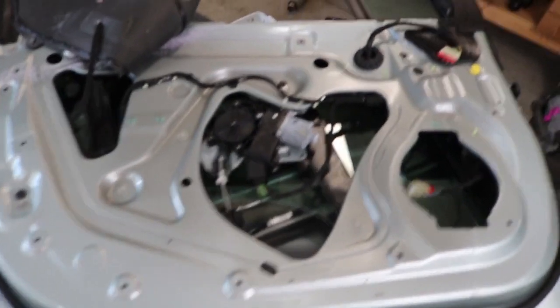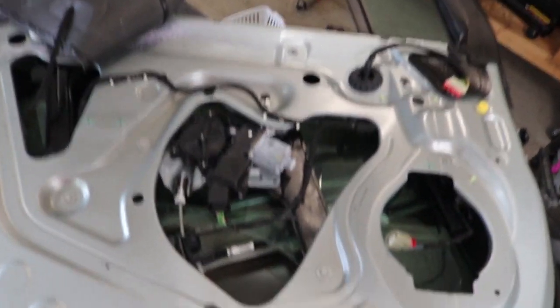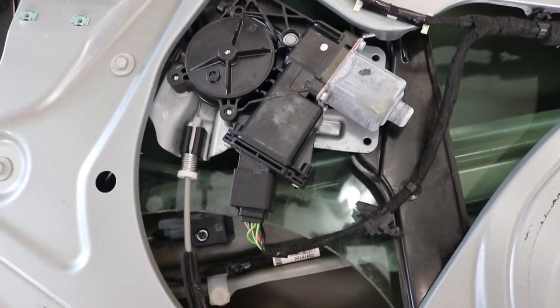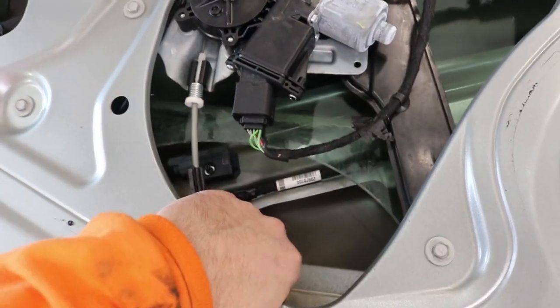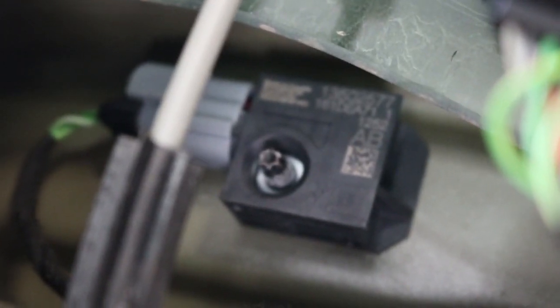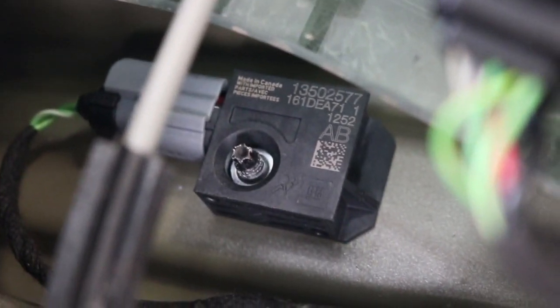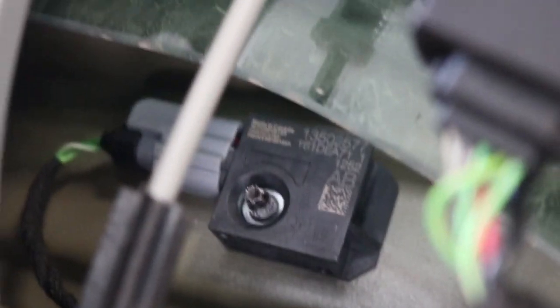Keep in mind the window was rolled down — it made things easier to handle, but the glass is kind of in the way of a few things. Here's the electric motor to run the window up and down. In the back door all of this was broken and none of it was working right. But if we look down here, that is the airbag sensor. Again, that screw is backwards, and I still didn't have the right tool to remove it.